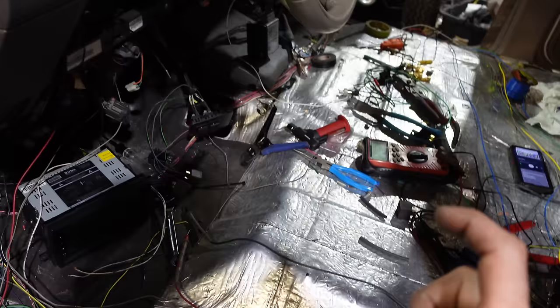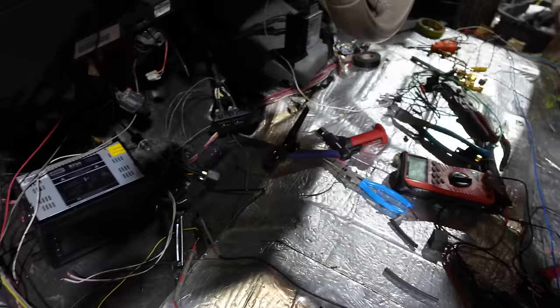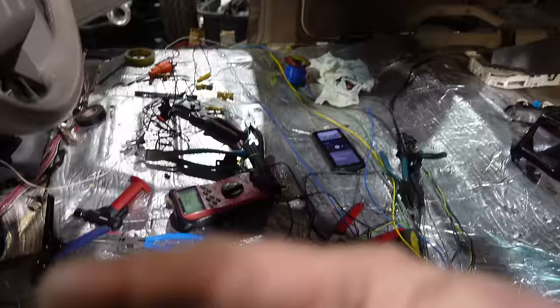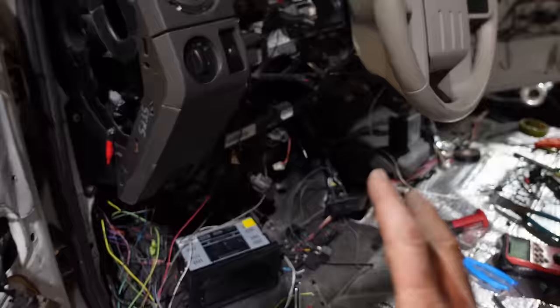Aaron is going to bring me my sensors so we can power up this side and run the airline in. Because the wiring is all under the dash, I don't want to run the sensors out to the side — we'll tee into the airline and bring it into the cab. I have to put my own pass-through on the bulkhead. I'll take a bolt, drill it, tap it pipe thread on both sides, run the airlines in, and that should work properly. They didn't have enough quarter-inch unions in town, but I've got my tees to get in there.